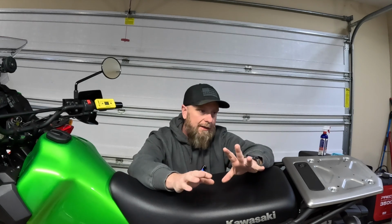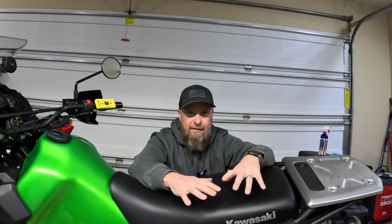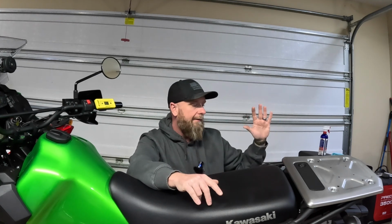We can crank it all the way up, and it'll get us around 83, 84 on the sag, and basically that's just way too stiff. I don't think there's enough rebound and dampening adjustment to overcome that without making it ride like a pogo stick. So, you know, I think it's unrealistic to say I'm going to set the sag back and have it ride just like it is by myself.